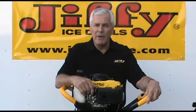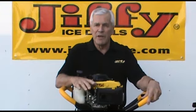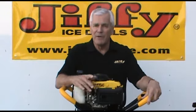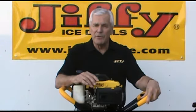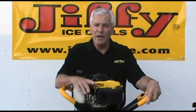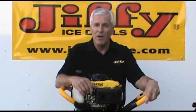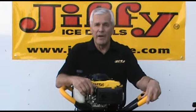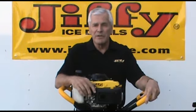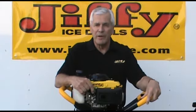The other thing we highly recommend is that you try and buy fuel with the lowest percentage of ethanol. Ethanol is very hard on carburetor parts, fuel lines, any petroleum-based product or part that's in the engine. So it's highly recommended that you try and find fuel with the lowest percentage of ethanol, or preferably no ethanol at all. We realize that this fuel costs more, but in the long run it's going to save you a lot of headaches as far as repairs and concerns that you have with the unit.